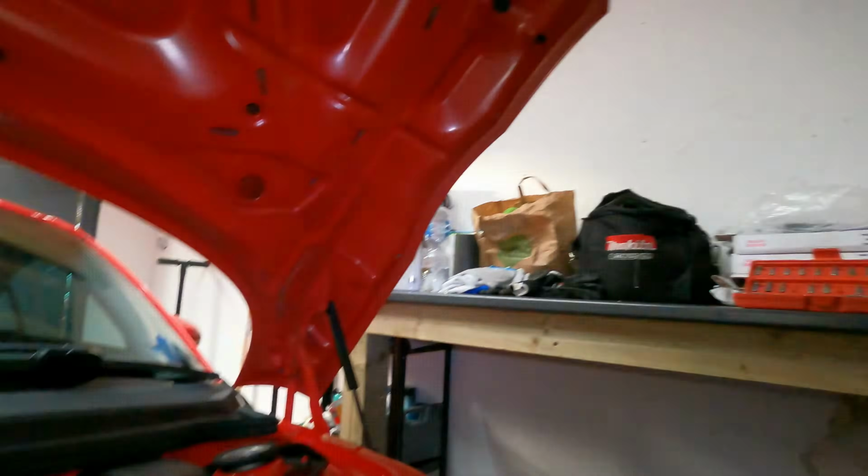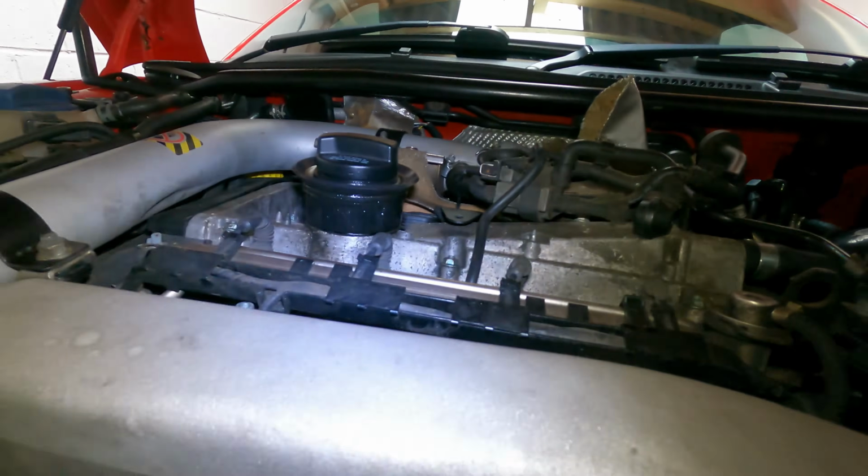So I looked at it and it's like, okay, some idle control valve. But it's probably more likely to be a vacuum leak than the idle control valve. So I've obviously started looking around everything, checking all the vacuum lines, thinking PCV stuff. But obviously we removed the PCV, so there ain't much of that left. So it could only really leave that little bit. So I had a little feel around there, and I could feel it all mushy at the bottom where it had obviously blown out. So hopefully that has sorted it.